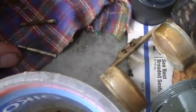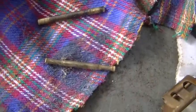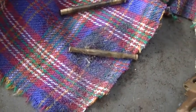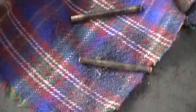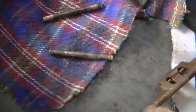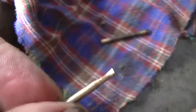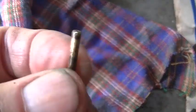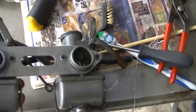Can you see that float pin right there? How tapered that one is at the ends — that was in there. But I have another one, so I'm going to put that one in there because that's as loose as a goose. These just have nothing like that — they're just flat. Carbs are all set, I hope.